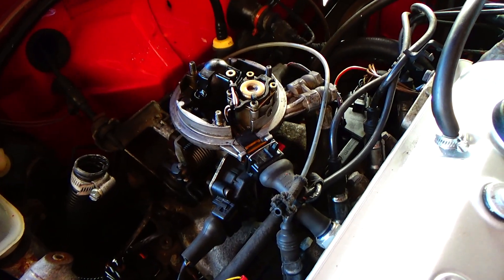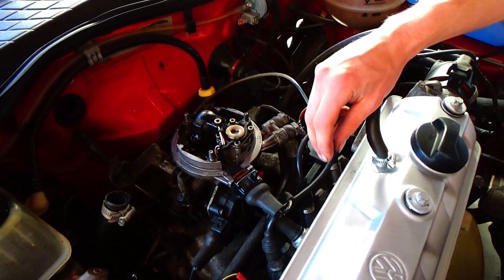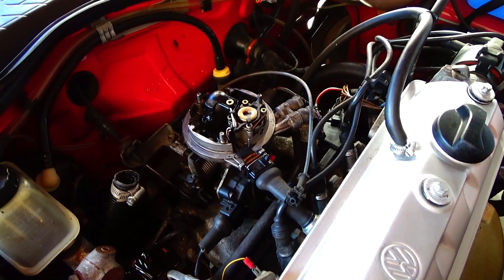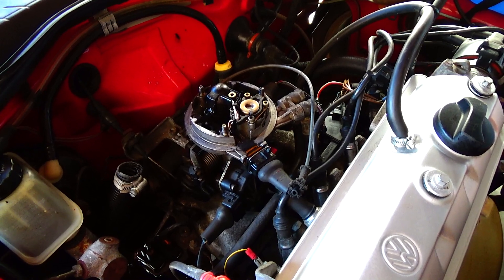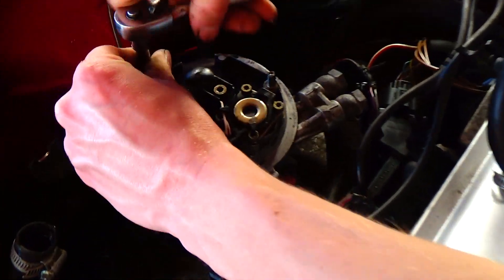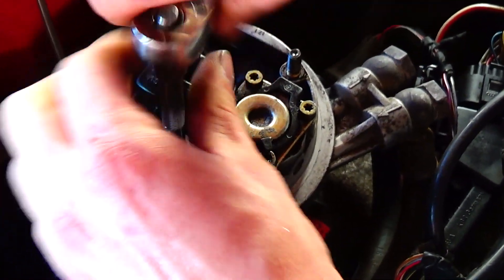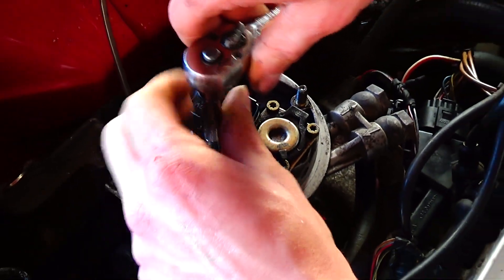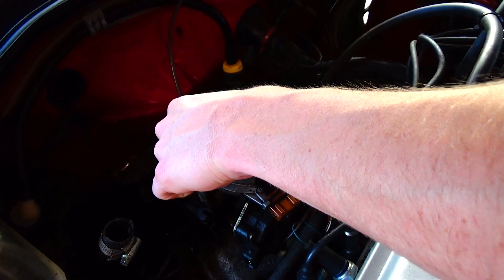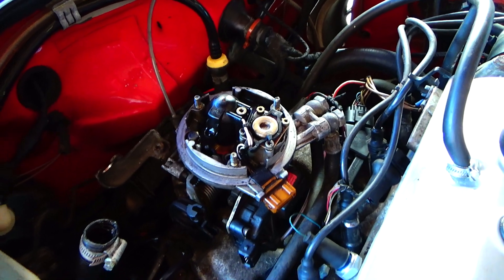And there's the carb on the 1.3 engine. Are they the same on the 1.0 litre? I think it's the manifold that's different — don't quote me on that. There are 4 bolts attaching the carb to the flange — M10, so just 10mm.